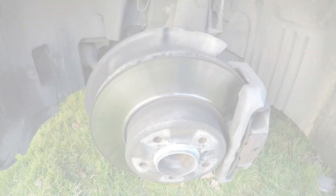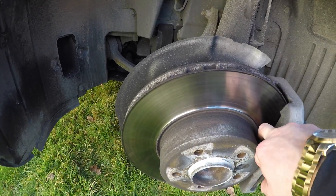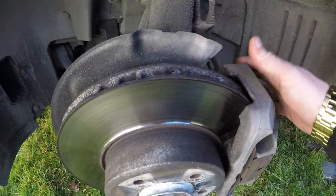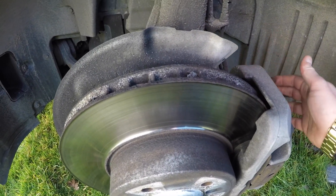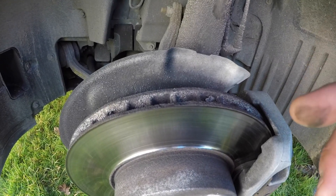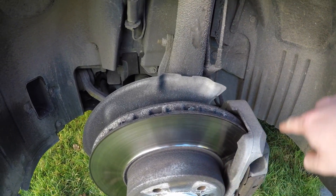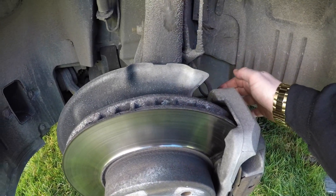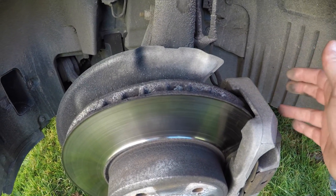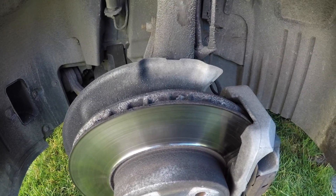As you can see, the front brake discs look quite bad — scored and scratched. The brake pads don't feel too good either; they feel quite weak and very flat. Before you take this off, you're going to want to turn the steering wheel towards the caliper side so you can see the bolts — if you're in the UK that's the driver's side, in America it will be towards your passenger side. The bolts sit behind here — they should still be a 7mm allen bolt. Remove the bolt caps, remove the bolts, the caliper will come off, then take off the carrier, and the disc comes off as well.